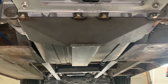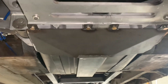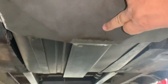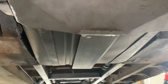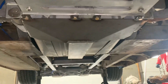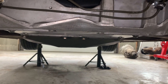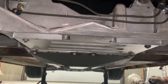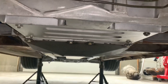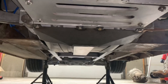You've seen the upper side of the fuel tank. Here's the pavement view — if I come across something that's a little high, hopefully it just hits this skid plate and skims right out the back without denting or damaging my fuel tank. That fuel tank does hang about three inches lower than the crossmember up front for the suspension, so it is the lowest point on the truck right now. That's why we built this skid plate.